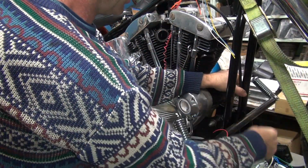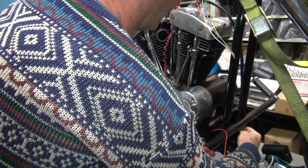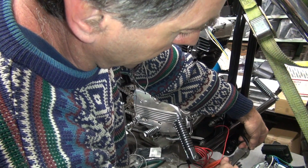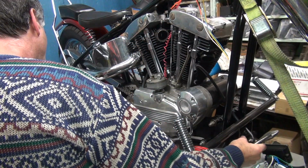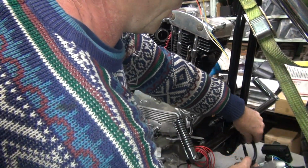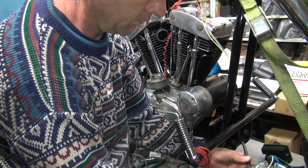So that means I'm going to go ahead and cut this thing somewhere down in here. So I'm thinking about right about this area here. So you come out a little bit. We'll go ahead and take a little pie cut out of here. So you do a 45-degree that way. Yeah, it's hard to do when it's stuck in here. Pull that out. Okay, now I got more access. And I do another pie cut this way. Once again at the 45-degree point. Boom.